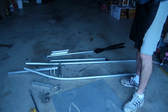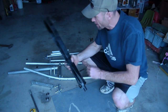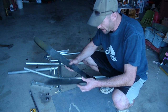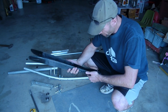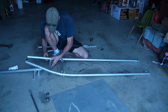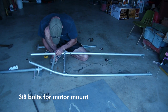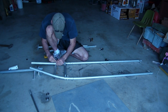The prop itself — this is an old damaged prop that I had repaired. I haven't sanded it out yet so it still looks a little rough, but it's balanced out and I'm going to sand it down some more. I may have to do a little bit more balancing on it. This is a folding prop that I had originally broken but now fixed. Tried it out on my other powered harness and it worked just fine, so I'm going to use it for this one. And again, these would all have lock nuts — right now I didn't have enough, but when I get ready to fly it I'll replace all these standard nuts with lock nuts.